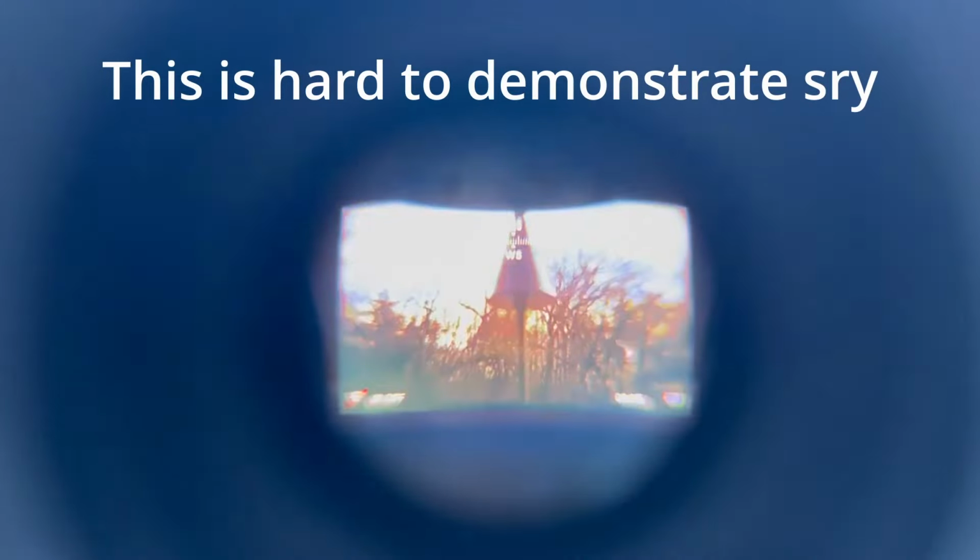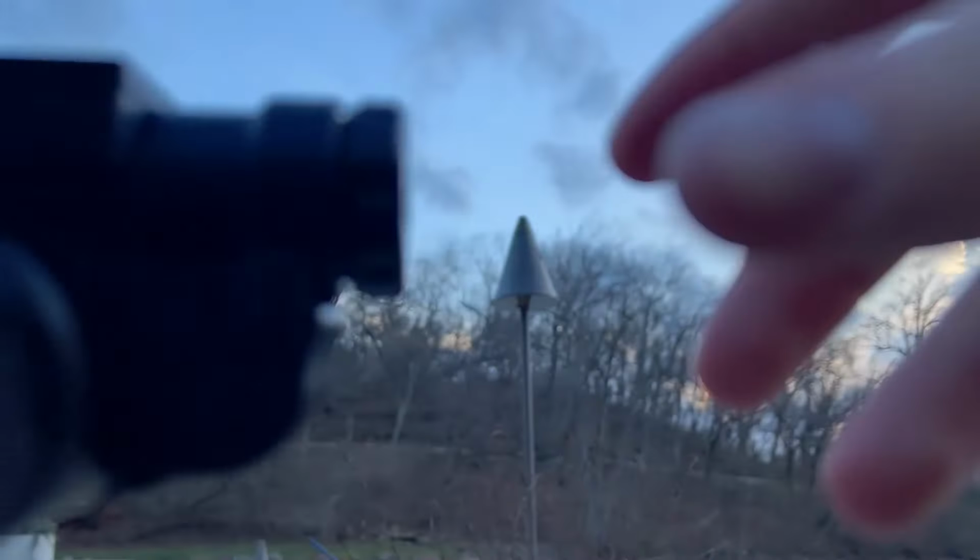The display is properly sized to the field of view to get a 1x view and doesn't feel too big or small. It has a refresh rate of 30fps, which can feel a little laggy. If you look around too fast, you'll get a really bad wavy effect from the input and refresh delay. This is probably one of my biggest complaints with the device, but I'll get to that in the opinion section.